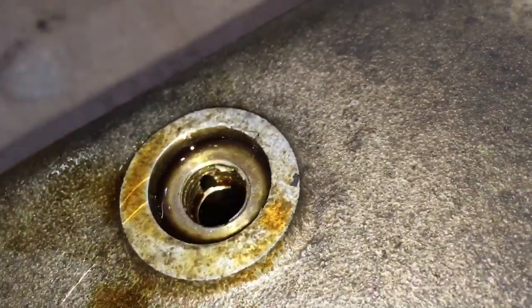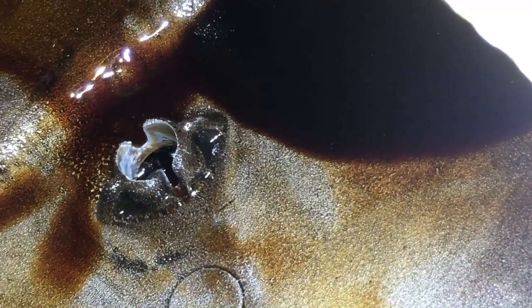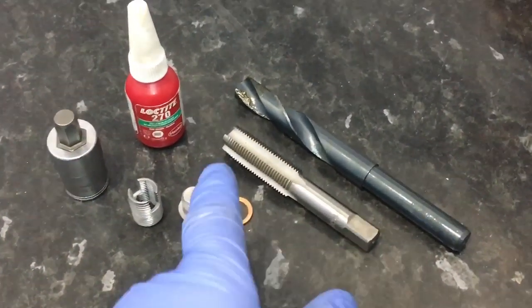The sump has now been drilled out. You can see the sump plug casting with the thread in it — originally still quite a bit of thickness left, but there's no thread left in it now because we've drilled it out ready for the special tap, which is part of the BMW toolkit. When I turned it upside down, I stuck some blue roll to the back edge so that during the drilling process the swarf would land on the blue roll, which I've then taken out. We managed to get pretty much everything out all in one go.